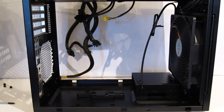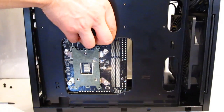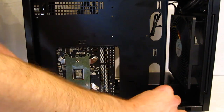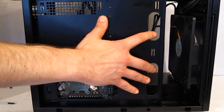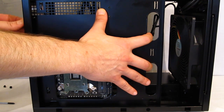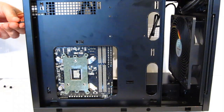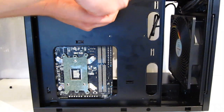It's now time to get the motherboard tray back into place with the completed motherboard on it, and we'll just bring it around back and it will drop into its slot. Make sure you align all the clips, pull back, and the tray is into place. Use the rear screw to secure it and pull it into place. You can then put the final 2 holding screws into place.